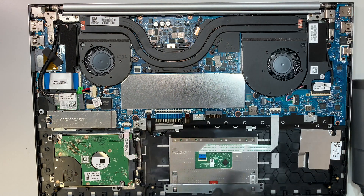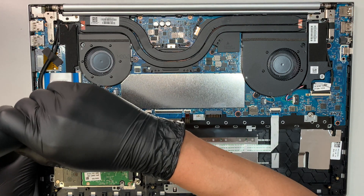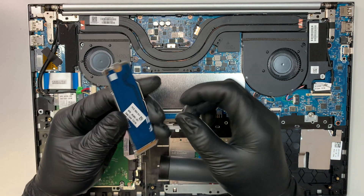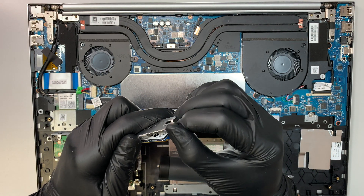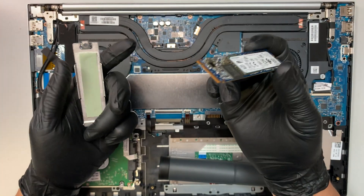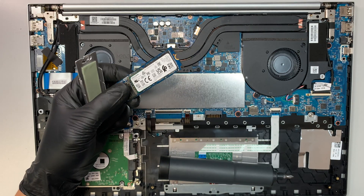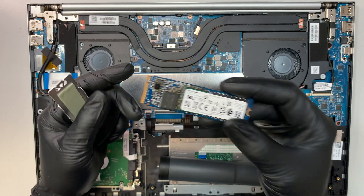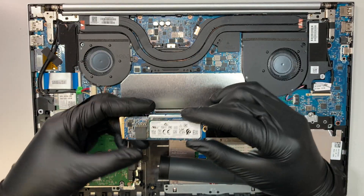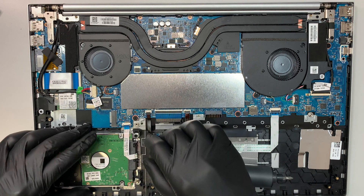This is the hard drive. In this computer the primary C drive runs on an M.2 drive. Once I unscrew it and slide it to the right, that's how you remove it. For those of you trying to upgrade the M.2 drive — this one is 256 gigabytes, as you can see. If you want to upgrade to 512GB or one terabyte, I have a separate video linked in the description that shows how to clone the M.2 over to a larger M.2 so Windows and all your programs stay the same.